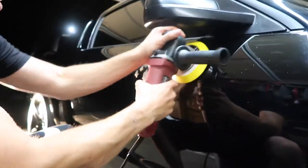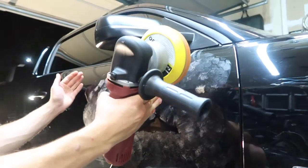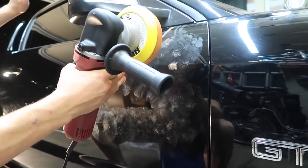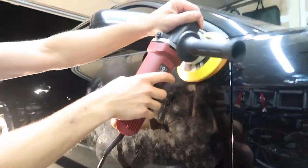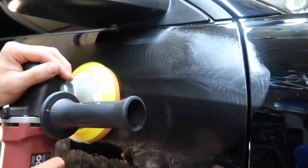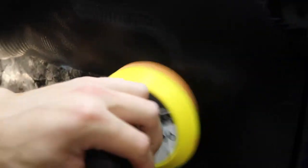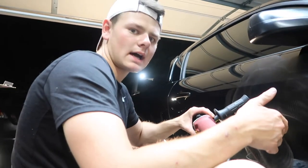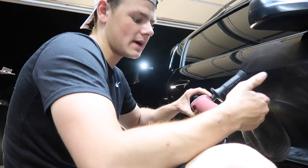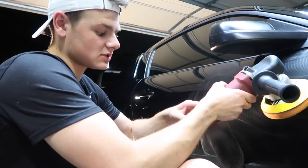Again, with the speed - first you're going to want to just dab it out in the area you're working. Don't work in big areas. This is about as big as you're going to want to work, because if it's too big you're going to start missing stuff and it's going to be a huge mess. So start on your lowest speed setting, just work the polish into the paint so you don't have any spray - this is literally just to get a light, even coating all over the surface you're working on. And once everything is coated, kick it up to the high speed - kick it up to the highest your polisher goes. Don't go fast when polishing. If you're going fast you're going to do no good for your paint. You want to go slow. This is a slow process.